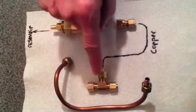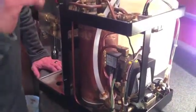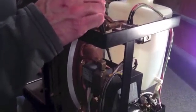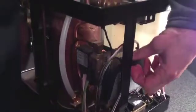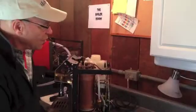From the boiler room here — if you remember at the beginning of the video, we thought we were going to put the OPV valve in this general area right here, which was right on top of the P-stat. We didn't realize that if we did that, we wouldn't be able to remove the cover of the P-stat, so this whole space there needed to remain clear.